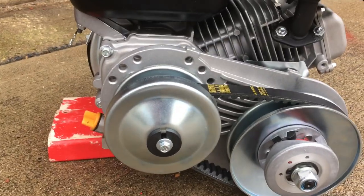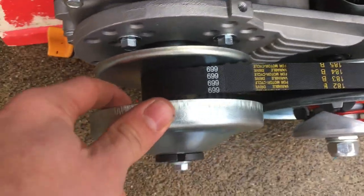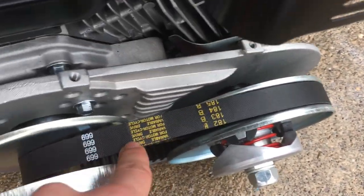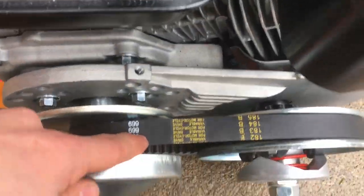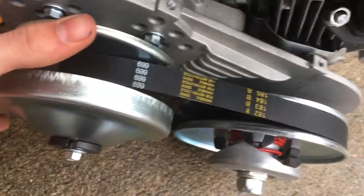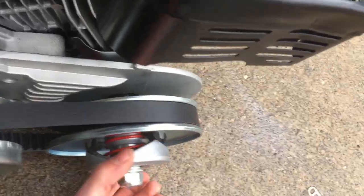Saw the torque converter working. So as you saw here, kicked out, it actually changed the size of the pulley. So down low it has this torque from small to big, but whenever it got more RPM, this belt actually came out, became bigger, and this became smaller, applying less torque but more speed.